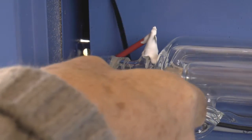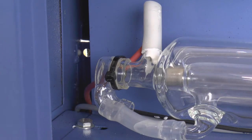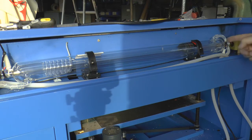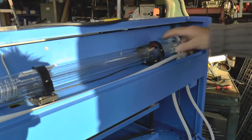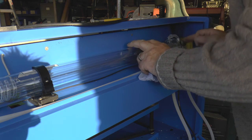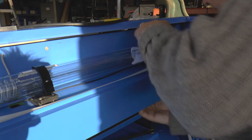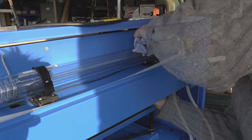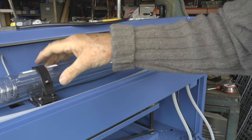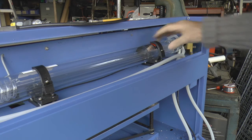There's some adhesive around the joint, and when I turn it down it can't come off anyway because it's going to be sitting down on the deck with this piece at the top. Let's put this tie wrap on here because I remember that's how it was fixed on before. I'll put a bigger tie wrap around there just to hold it while it's dry — hopefully that will keep that in place while the glue dries. I don't think it really matters how far the tube is away from the mirror, but there are times when you want to get in there to do a mode burn test, so I'm going to leave about an inch of gap. I haven't locked these up yet — it's still floating — so I'll line that up by eye with the centre and tighten up the nuts underneath. The important thing when it's all tightened up is to make sure it doesn't move in any way from side to side.